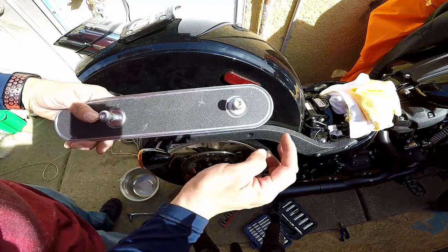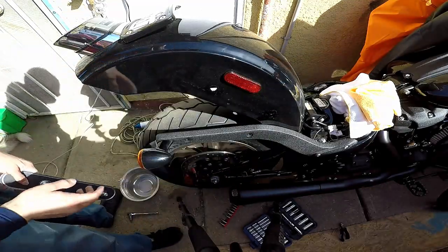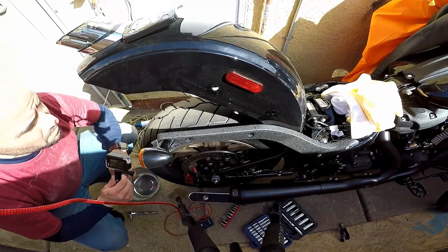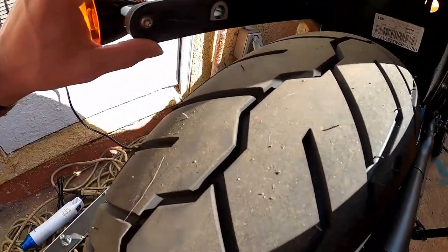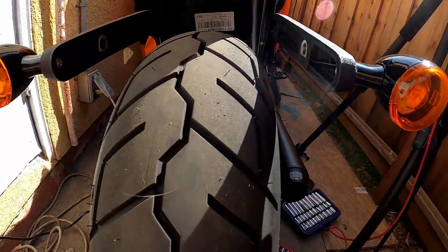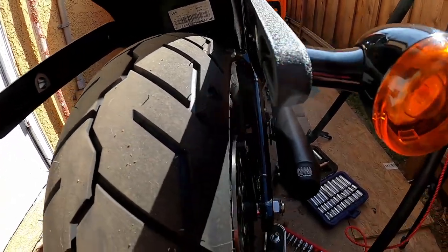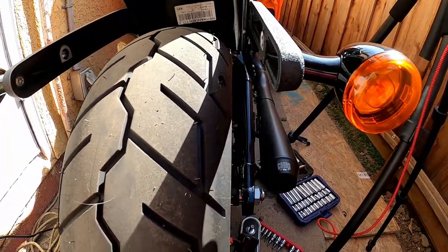Make sure you leave this on the inside — this goes on the outside, the longer side. You don't have to undo the other bolt on the inside. Now we've lifted the fender — be very careful about scratching your paint job, take your time. These are the bolts we have to remove to get these lights out, and then we're going to disconnect these wires so we don't have to remove the main fuse.